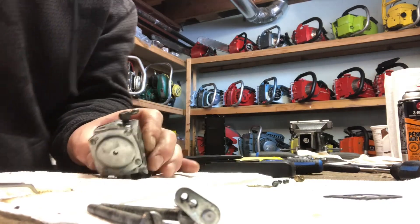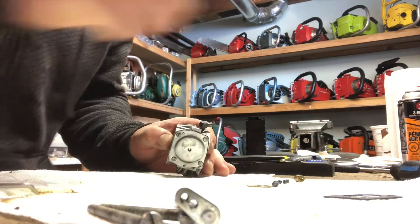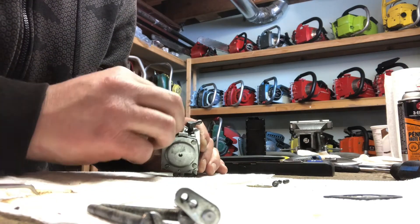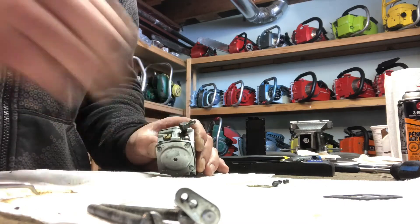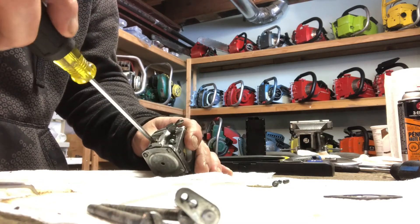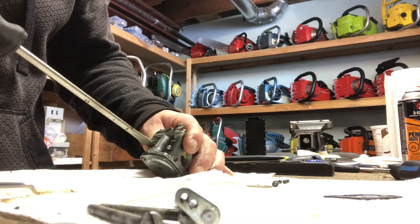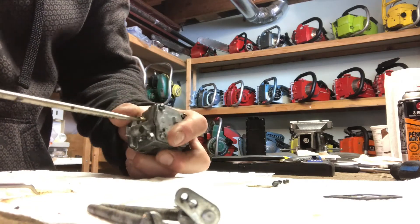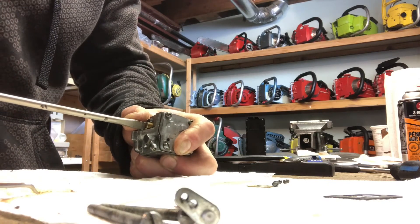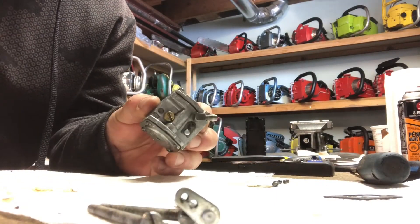Put that away and the next step is to go ahead and put that governor plug right back in — it's not going to work now because it's blocked off, and that's what we want. We want to be able to control the fuel flow just with our own jets. I thought about putting some sealant on the threads, like Moto-Seal. If I pressure test this carburetor and I'm getting leaks, I'm going to try putting some Moto-Seal on. The little valve is back in there.